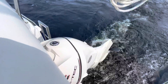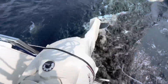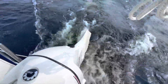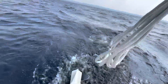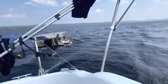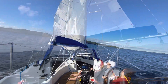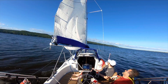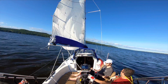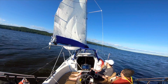What a difference. Now I can actually enjoy sailing without having to hang on to the steering all the time, because the weight of the engine kept bringing my steering to port or starboard depending on which side the boat was heeling. It's much more pleasant. I also discovered I could leave the engine disconnected and locked in a straight line and steer with the rudders at low speed. When I'm ready to hoist the sail, I disconnect the engine, lock it in a straight line, and steer the boat with the rudders into the wind to hoist the sail.